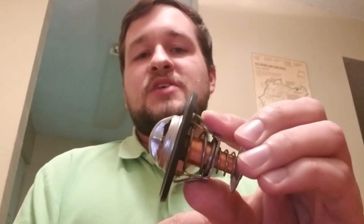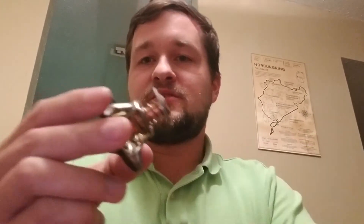Just wanted to give a little rundown of why you need proper thermostats. This is just a Rock Auto special — I always buy fail-safe. What fail-safe means is: if the car starts to run warm and the thermostat is wide open, it goes an extra step and at a certain temperature will physically lock the thermostat open so it will never shut again. If that happens and your car cools back down, you have to replace this thermostat if you ever want it to work again — once it's locked, it's pretty much built-in trash.